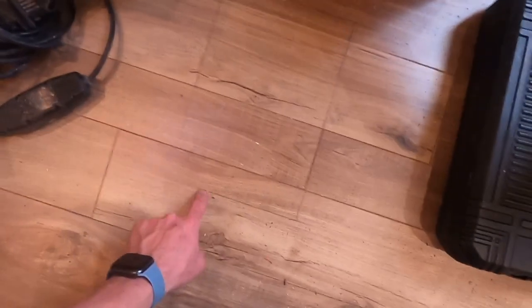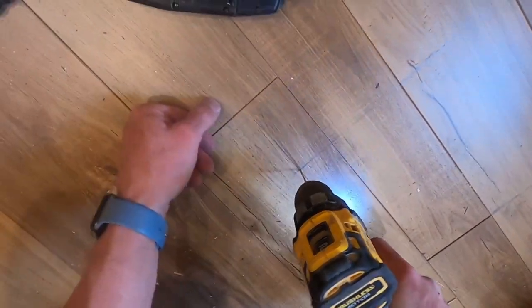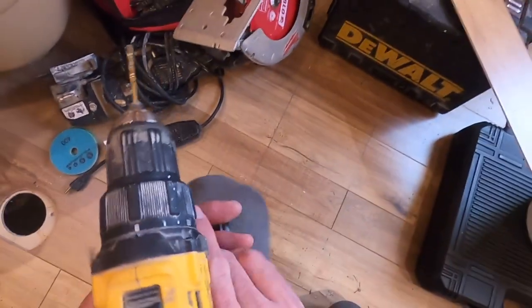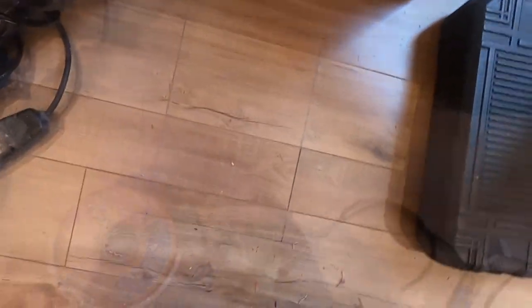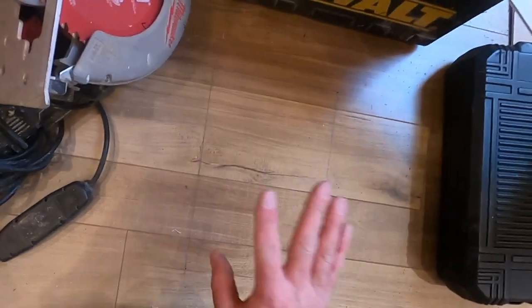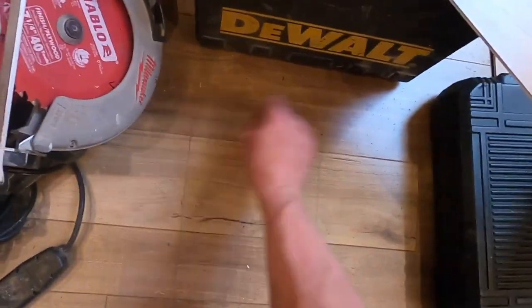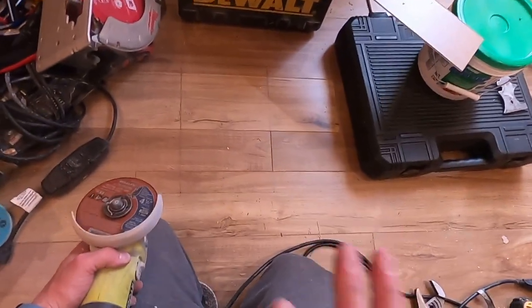I have a little bit more to go on the actual floor and then I'll get into how I'm going to cut these hatches. I've been looking at other people's hatches and they're all kind of jacked up — I really don't want that, so I'll try hard to make it as clean as possible. I have three or four more rows and then we'll work on the hatches. Next up I'm going to cut out my first access panel. I'll stop with little eighth-inch holes — one, two, three, four. Then I'll take a cutoff wheel on my grinder and cut this out for a nice clean cut so I can put it back and make it look really good.